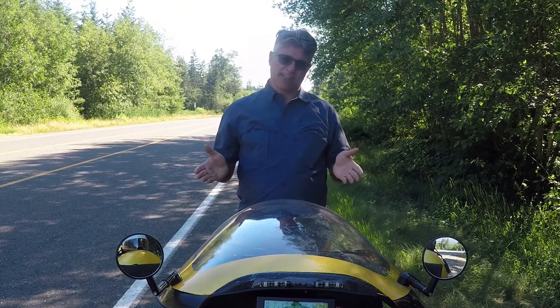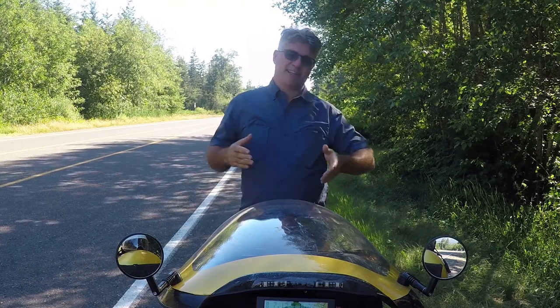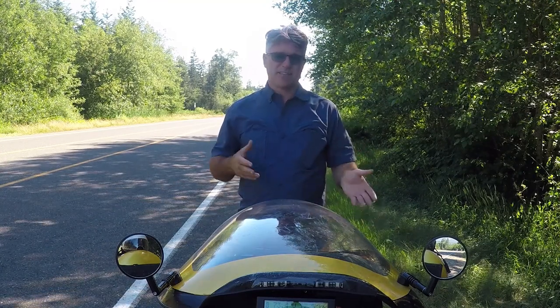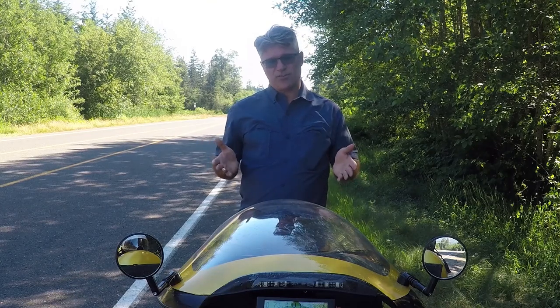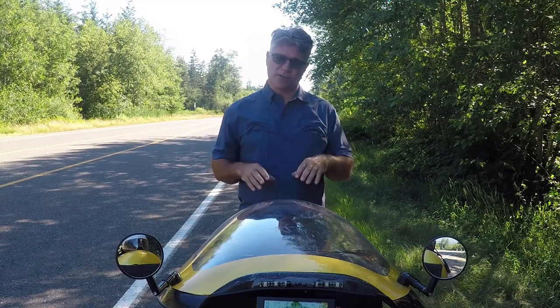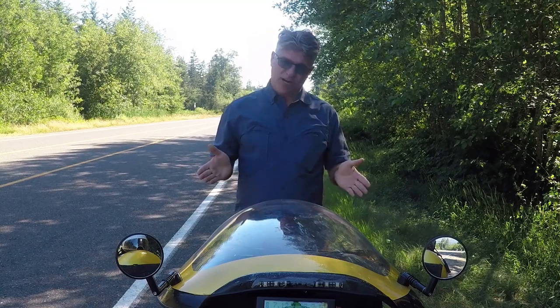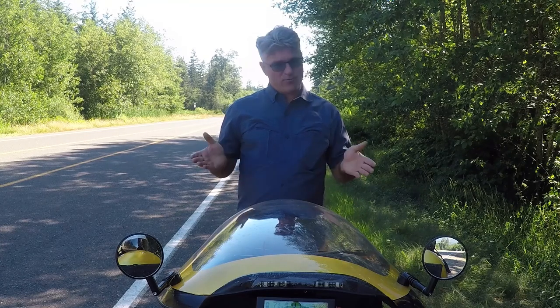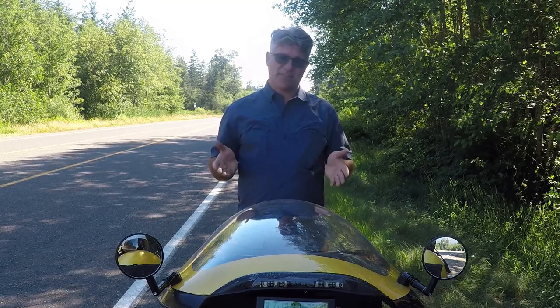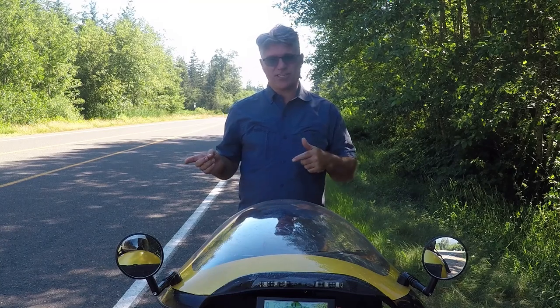This is something you really need to consider when buying a bike based on what you're going to use it for. I love mid-drive electric mountain bikes — they work great and remove unsuspended weight — but you have to be aware that you're not going to have regenerative braking. You can't have it, in fact, because there's a freewheel between the motor and the wheel. On the Electrum we're running two motors: a geared hub motor in the front which helps with hill climbing and low-speed acceleration but shuts down once the vehicle's over a certain speed to conserve power, and a direct drive hub motor in the back that supports regenerative braking. When you're coming down a hill as steep as Mount Washington and topping out at 88 kilometers per hour, it's really nice to have an additional braking function beyond just your bicycle disc brakes.